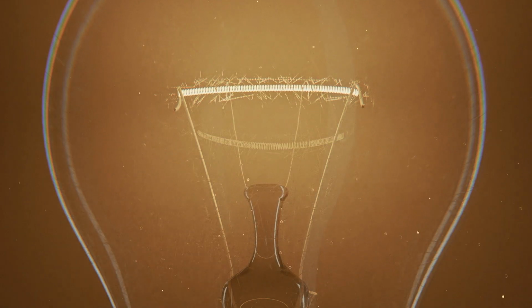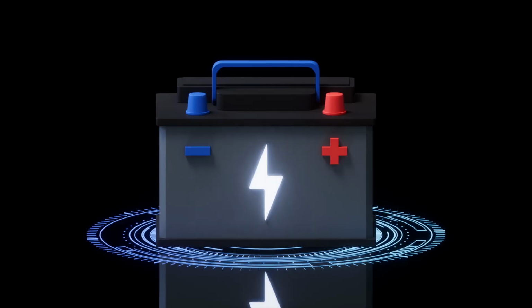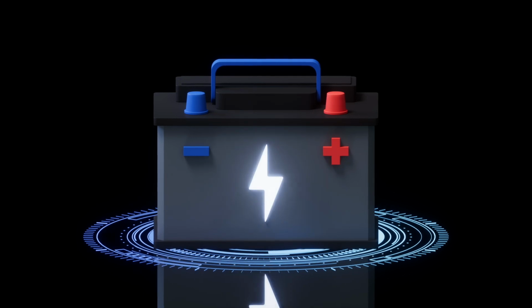because the anode and the cathode are separated, then the ions that are released by the anode will be able to travel through the wire and go through the cathode, which creates an electrical current through that wire, which is why batteries work, which is why I call it electrolysis, even though I'll say it again, it's not completely accurate, in the metals in the boat. One metal will want to release some ions and the other metal will want to receive it. It causes a little tiny current, and that's where you get all this damage to boats like this.